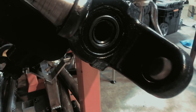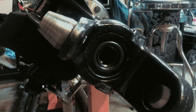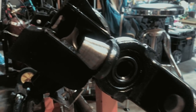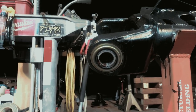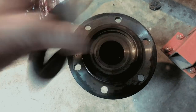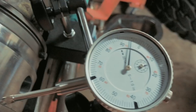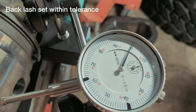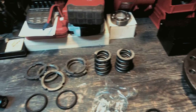You're going to see here some of the seals that I've started bringing in to get this thing dialed down. This is the inner seal — it's going to keep some of the fluid inside the differential and stop it from leaking out. You'll see I've got the lower kingpin installed in here: the kingpin race, bearing, bushing, and everything. Down here I've got some more stuff — this is the rebuild on my hub, new bearings, new seals, all the good stuff. The Detroit is in. And coming over here, I've got all my rebuild for the kingpin.